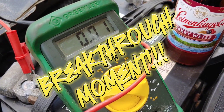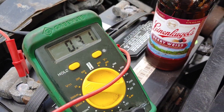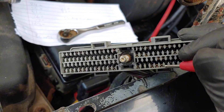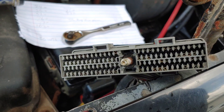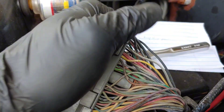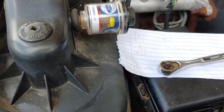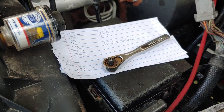Pin 71 — doesn't seem to be getting anything. And pin 97 — nothing there either. So for some reason I'm not getting any power there or there right now. I do have the ignition on, so I'm not sure what's going on. I'm going to have to look into that. Those two red pins on the flip side there — I do not have power there, and I've already checked all the fuses, so I'm going to go through and check the fuses once more and try to find out why I have no power to the PCM.